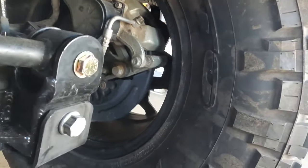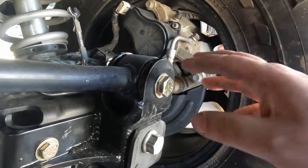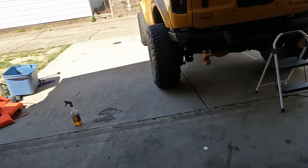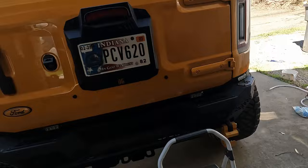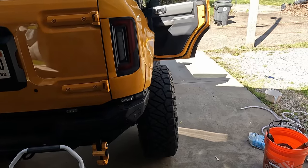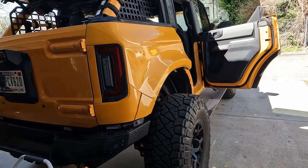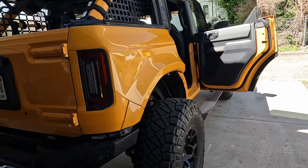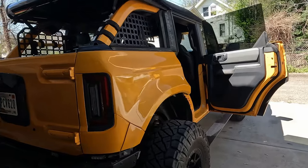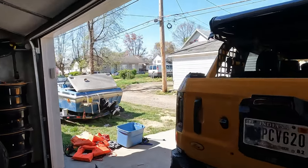I need to torque this to 170 foot-pounds, so let me get this tightened down. So while I was editing I realized I had never finished this video, but we got everything back down and actually we shifted it the other way just a little bit — not quite as far as we were. An adjustable track bar is probably in the future. I'm going to bring it down a little bit since I have the spare off the back. The back does sit up a bit higher than it did — I know that because now it scrapes coming in or out of the garage where before it did not.